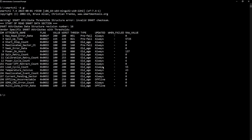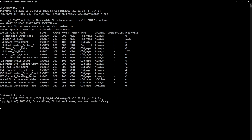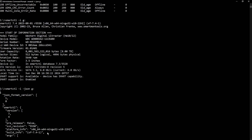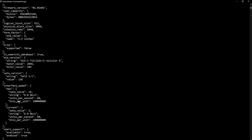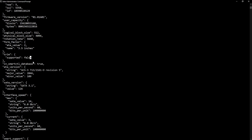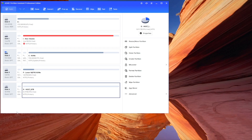Looking at the SMART data, the drive is labelled as part of the Western Digital UltraStar HE10/12 family, but this isn't likely correct and may be based on incorrect data in the SMART database. The 'HE' designation specifically signifies a helium-filled drive, which for a 5640 RPM 8TB drive is pretty unlikely — we'll know for sure once it's opened. It's also a 512e drive, meaning 4K physical sector size and 512-byte logical sector size, and it reports that it doesn't support TRIM, making it unlikely to be SMR — though some mainly Toshiba drives do appear to be SMR without TRIM support, so this isn't a slam dunk.